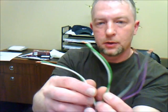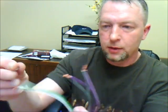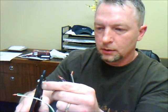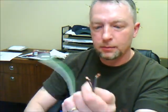So, front rear jump. Once again, instead of wasting your money running out the wires, do it the same way. Save time. Save you at least half. Connect your fronts. Front left to rear left. Cap them off, get a couple of crimp caps, whatever. I like these the best. Throw that on there. Again, look at the crimp before you crimp it. There you go. That thing ain't coming off. Front left to rear left. Front right to rear right. That's a wrap. Pretty cool, right?